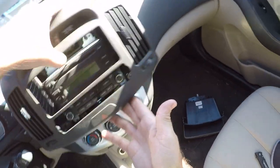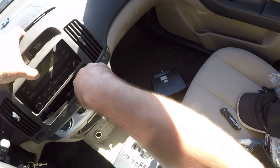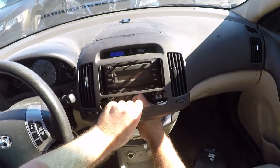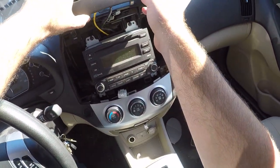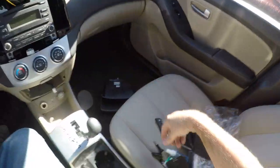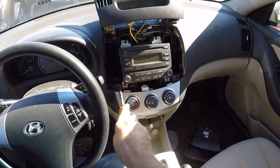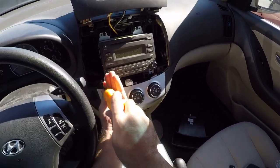You pull that out — it's got a couple tabs in there. I could disconnect this right now. But I can see the screws I need to take out right here and right here. Actually, I think I'm going to take this out. All I'm going to do is disconnect the hazard flasher, and I'm not even going to disconnect the clock. The yellow wire is probably an airbag sensor — yellow is usually the airbags. There are your four stereo screws if you were going to take out the stereo, but since I'm just replacing this module, I don't need to take out the four stereo screws.